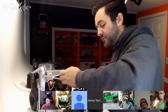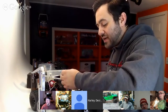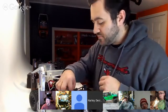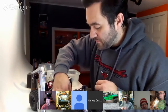Is that transfer case a 1-to-1 transfer case, or does it have any reducing in it? No, it's 1-to-1. What would be nice is if, with the 2 pinions set up, you could actually set it up to have an underdrive overdrive setup if you ran your drive shafts on offset outputs. But that's not what we have here. It would be nice to be able to get that out of a stock set of Vaterra axles, though.